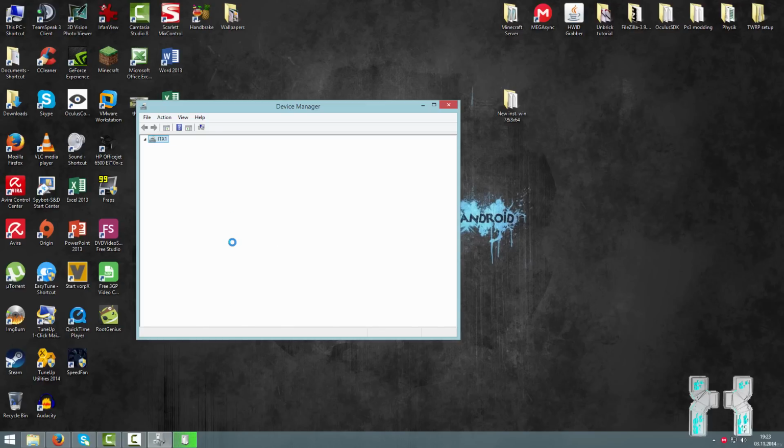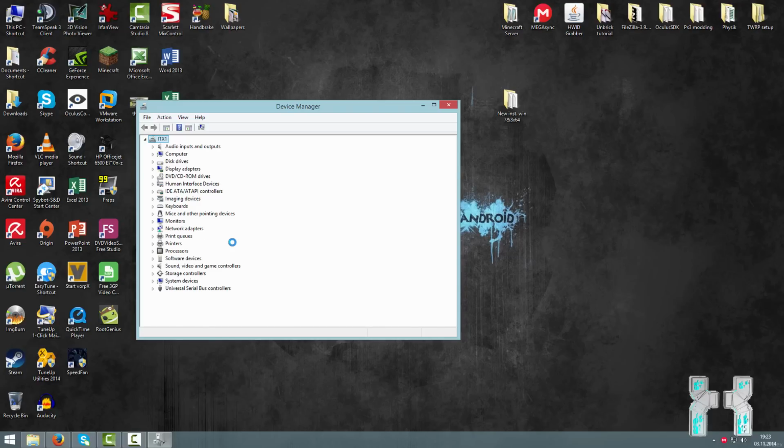And yeah, let me disconnect that. And for instance, if I now keep holding the volume button and I just connect it, then I should just get the MTK USB port. And now we're good to go, and now I can actually flash the smartphone because the MediaTek USB port stops after some time after downloading the preloader, and then you can download a new preloader and also download the whole ROM.